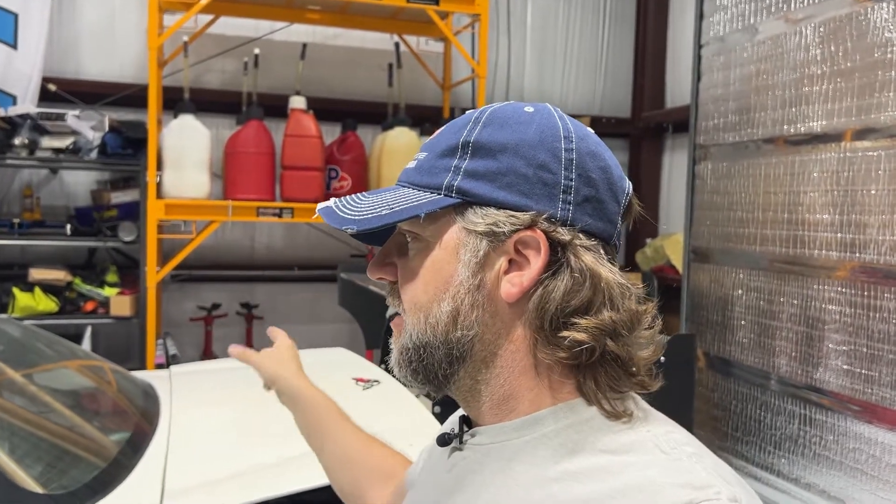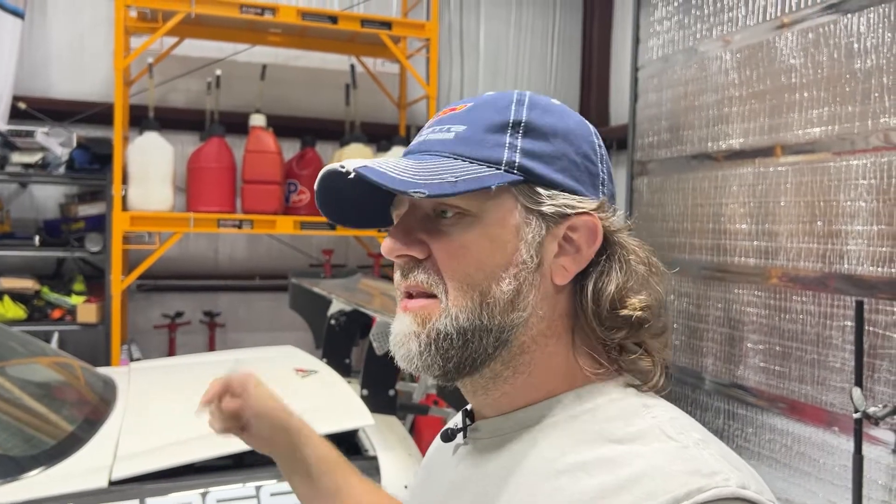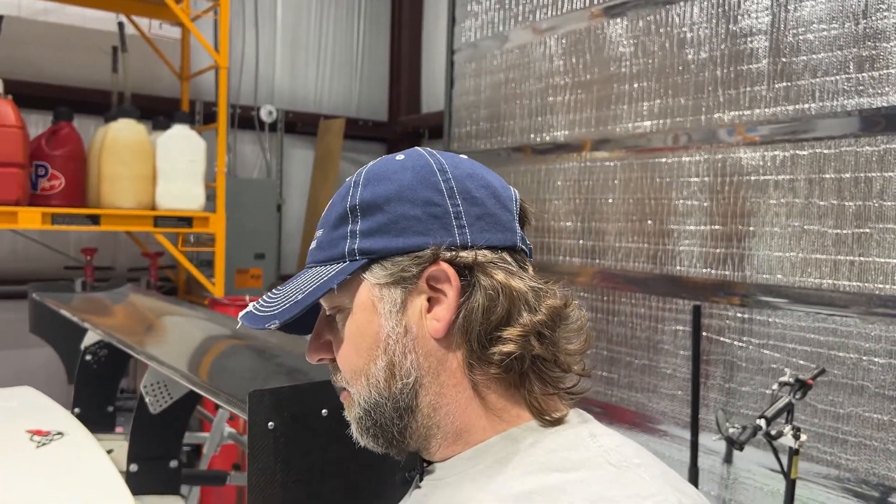Because I have temperature readings from the car, and that's what I'm chasing — the driver's side temperatures stayed pretty static, like 140, 140, 140 across the entire width of the tire, which is why we need a lot more camber added to that side. That other side, however, did have some change in temperature. So the camber on that side doesn't need to be more aggressive. If anything, this side should be more aggressive than that side for Sebring. I don't think I can go one more step here — we'd probably jump to 2.6, and that might be just a little bit too aggressive.